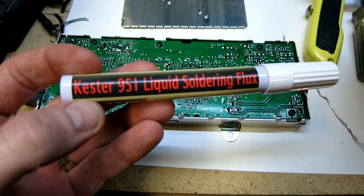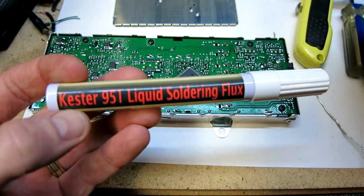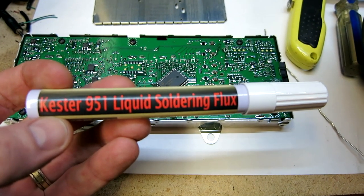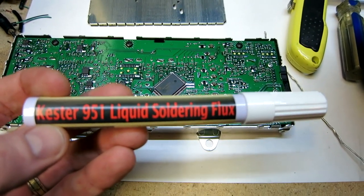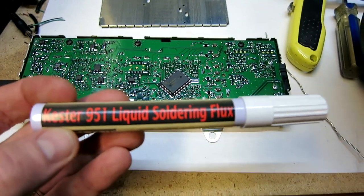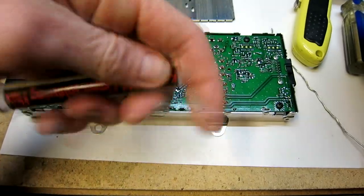I'm actually going to be using a Flux Kester 951 pen, and I'm going to go ahead and dab the locations where I'm going to be soldering. It makes life a lot simpler. The solder flows to the flux. I definitely recommend picking one of these up. Again, I'll have all this stuff listed in the description box below the video.